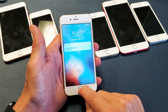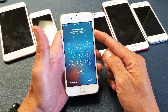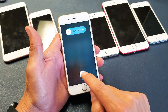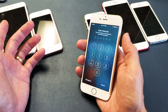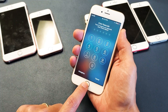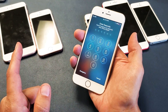And of course, if you're not able to punch in your numbers here, you're not able to turn off your phone and turn it on, because once you go over here and you try to slide it off, it doesn't slide, it doesn't do anything. Anyways, it doesn't matter where you are on the screen — what we're going to do is press and hold two buttons: the power button and the physical home button. We're going to press and hold both buttons at the same time and hold it and not let go until we see an Apple logo. Once the Apple logo appears, then we can let go.